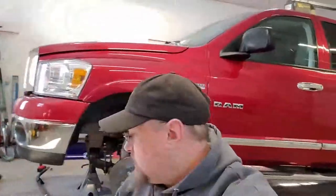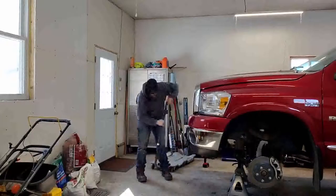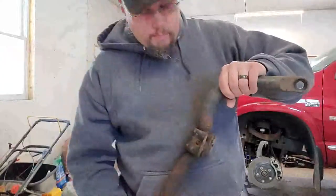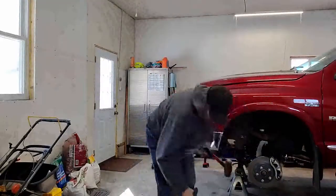That'll get into when we actually start getting the other setup for the rear and I figure out if I have to do something for the front. When you put this back together, make sure you put the rubber grommets the way they belong. I did toss my bolts back in for my front sway bar — I'll have to take the bolts back out when I put the frame protection on, but I did that so I don't lose them for the time being. I'm going to dig the sway bar out and take the grommets off. Here's our sway bar. There are grommets we're going to want to take off if we're going to prep this for any kind of painting or protection coating.